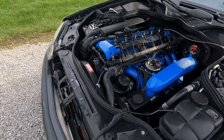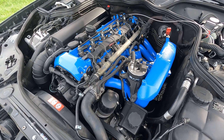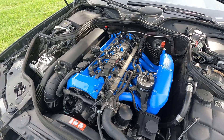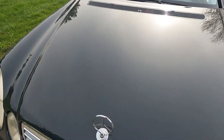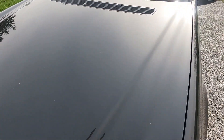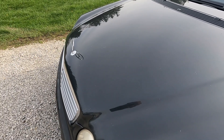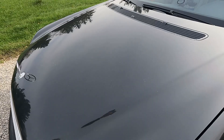It starts right out. Idle smooth. Running beautifully. I do note that when I close the hood, we wind up with a fair amount of vibration — you're going to hear and see that. The engine really needs new engine mounts. The engine itself is running smooth, but it's reaching some resonant frequency and the engine mounts are not absorbing anything.